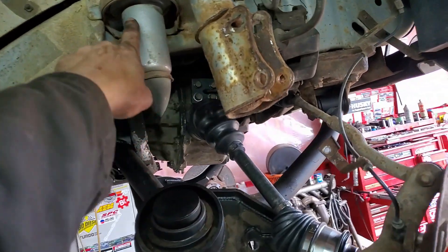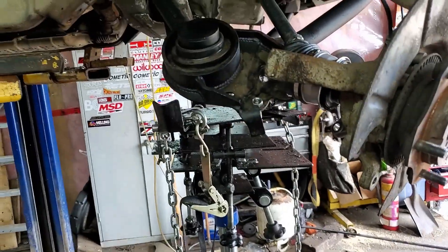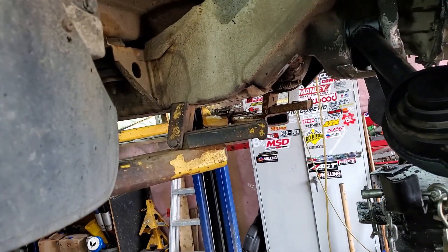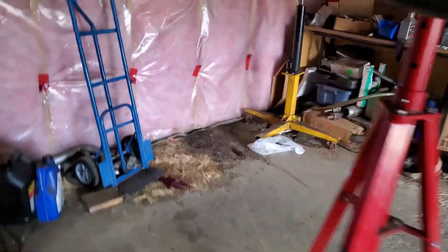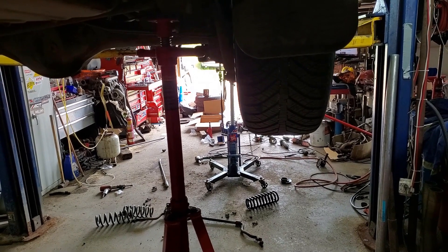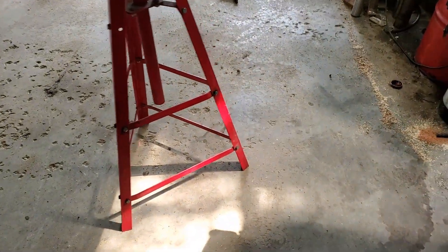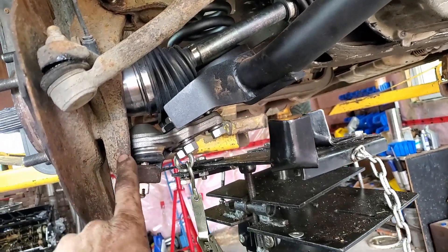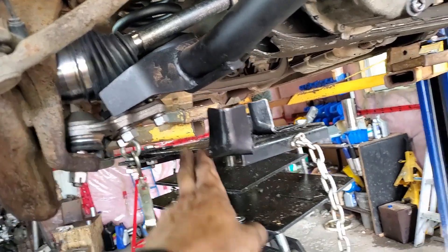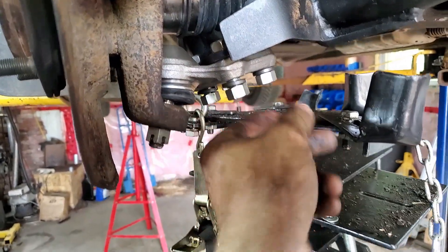I had to undo the ball joint to get the spring in with the isolator. I'm going to slip the spring up, put the spacer in that they want, get the lower isolator on, put the spring in, and then use the transmission jack to start pushing up on the control arm against the spring. Because I'm on a lift, I always recommend putting a brace at the back - I've seen too many videos where guys lift the front of the vehicle and it tilts off the lift and falls. So we're putting this brace here to prevent that. I had to have one bolt in place already because there wasn't enough room to get it in after.